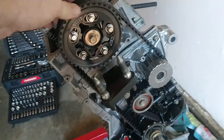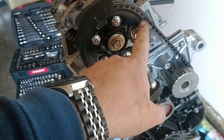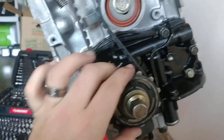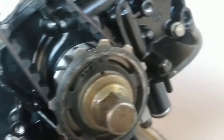Once that's on and you've verified that your alignment is at zero — mine's actually off by a degree because this isn't a stock build, it's all going to get adjusted in the end anyways. To align top dead center for the cams, you've got the equivalent of your TDC marks. These two lines need to be aligned in the horizontal plane with the cylinder head itself. Mine are not because I've rotated a little bit to tighten up the belt. You need to have your crank aligned with the crank pulley mark or crank gear right there — that lines up with the little arrow on your oil pump that tells you where top dead center is.